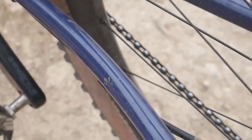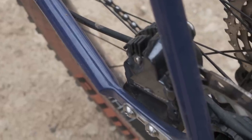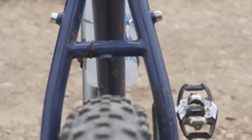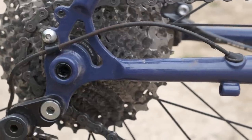Designing a bike to maintain the narrow road Q-factor of the cranks while getting the massive tire clearance you want is a really tricky job, because the space for the chainstays around the bottom bracket is really pinched in. The shaping on the tubes is quite impressive and they've done a really good job there. They've also managed to route the brake hose along the chainstay as well — no interference there.